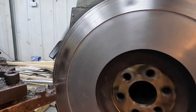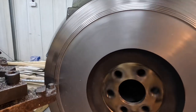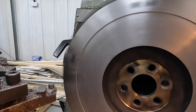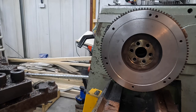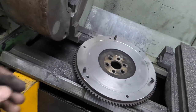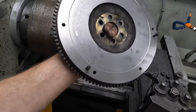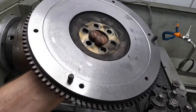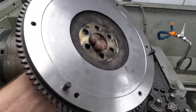The step I'm measuring is quite important — it needs to be 40 thou, one millimetre. What I'm doing there is measuring to take the right amount off the outer part of the flywheel to give me my 40-thou step for the clutch to work correctly. That was the final cut, and I was just giving it a quick measure to make sure I was at 40 thou. That's the flywheel all done — I had to take 45 thou off in total and I've put a 40-thou step back on it. All I've got to do now is tap the dowels in and wait for him to collect it.